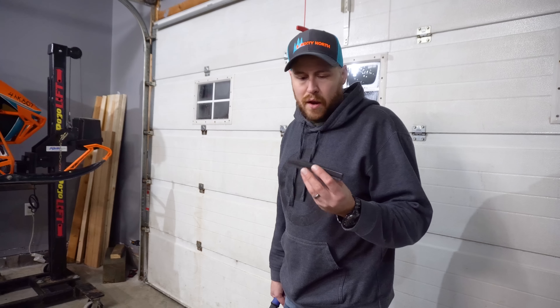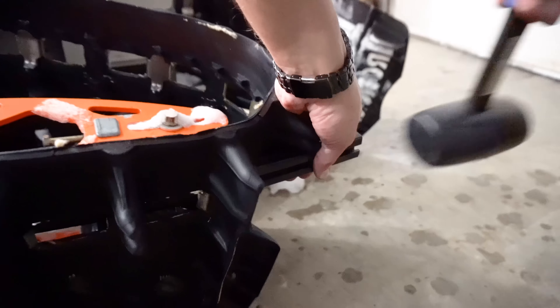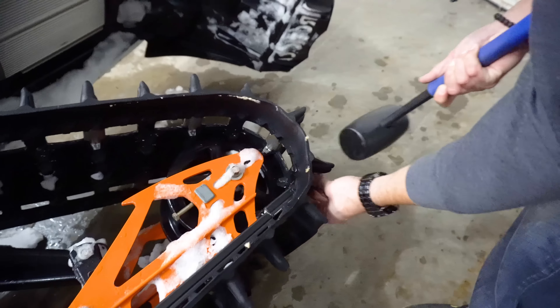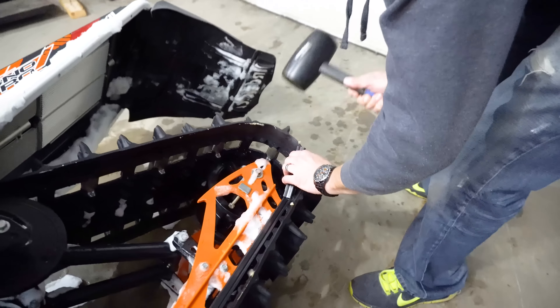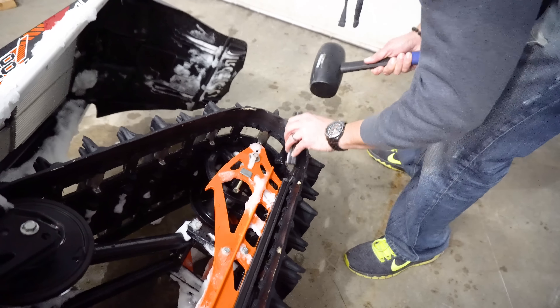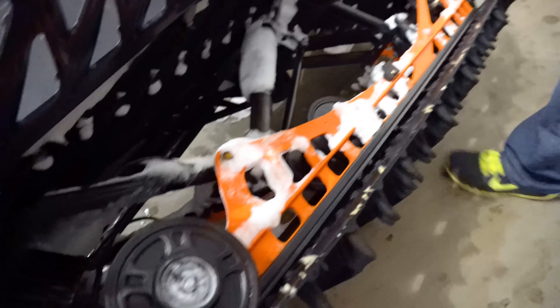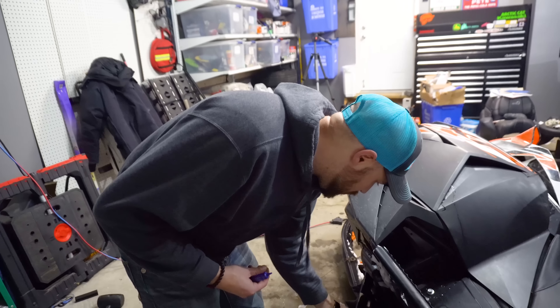Eventually your Wheaties will wear out and you'll get to a point where it won't want to go any further, and that's what your big hammer is for. I'm using a rubber mallet, this is like a 32-ounce. Eventually you're going to get to the track and you're going to find something that fits in the window that isn't going to split the slide rail, and you'll keep tapping it until you can finish it home. If you're a genius in your garage — which you probably are because you're watching our videos — the piece you cut off, you're going to use that to drive this the rest of the way home. Just line it up with the old piece and finish it home.